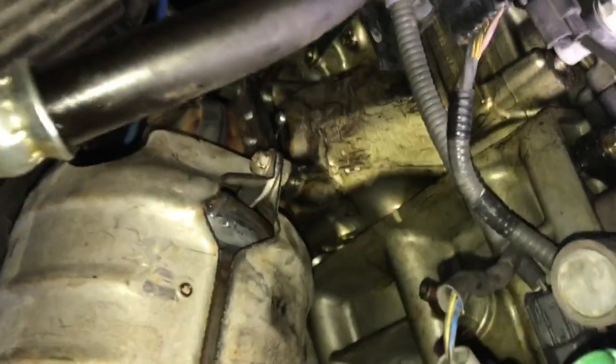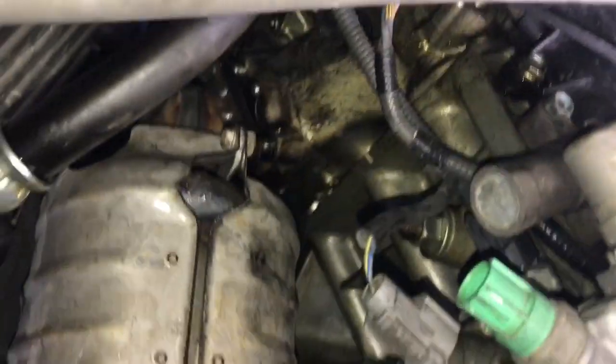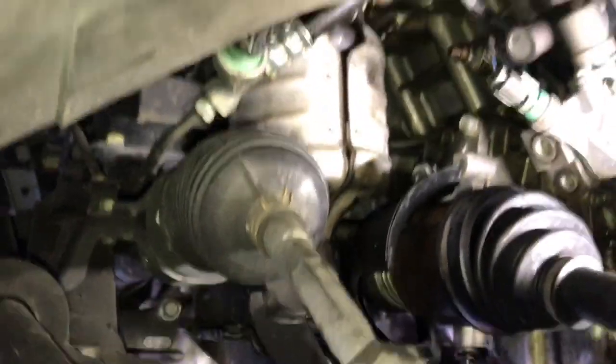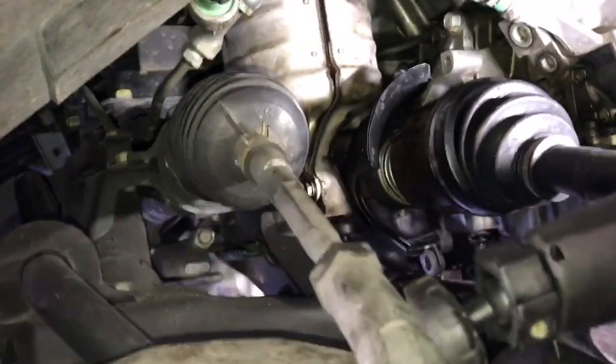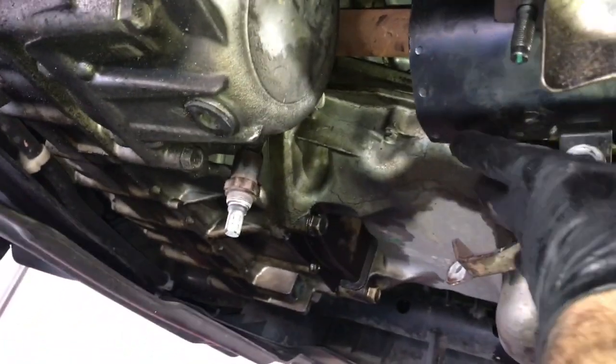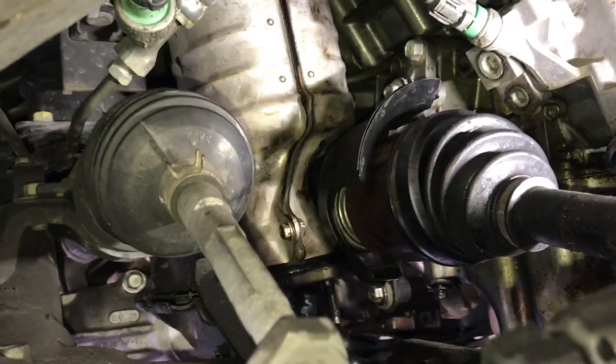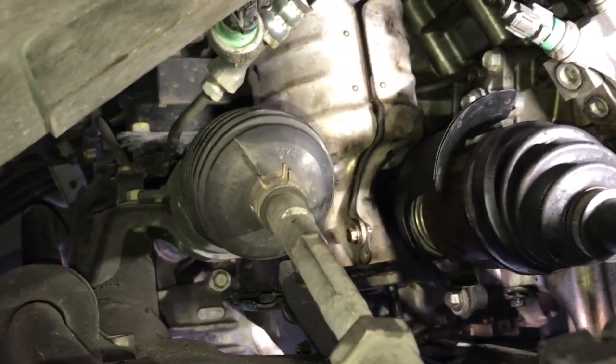Nose the cat in, rotate it clockwise, lift it up, and put it over the studs. After slipping it on and starting one bolt, leave it loose. Plug in the electrical connector for the power steering switch and start working in the heat shield that goes over the axle. I found it easier to duck underneath and come from the backside, sliding the heat shield over the axle and into position, then start the three bolts and tighten them. Lower the vehicle down and tighten the four nuts from the top.